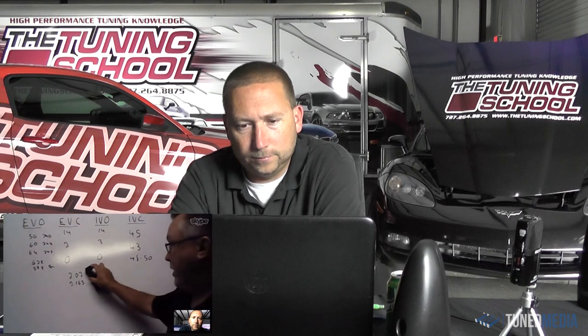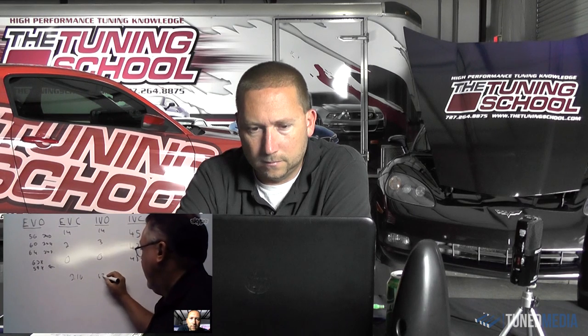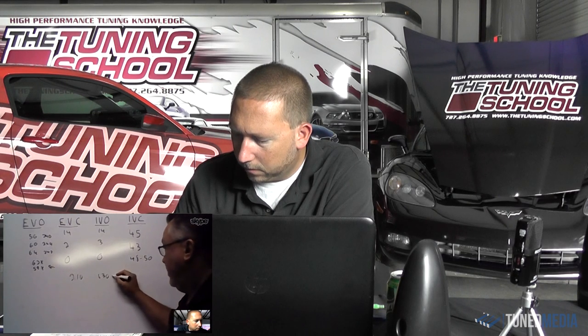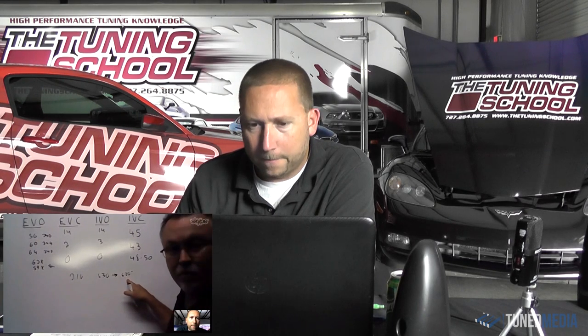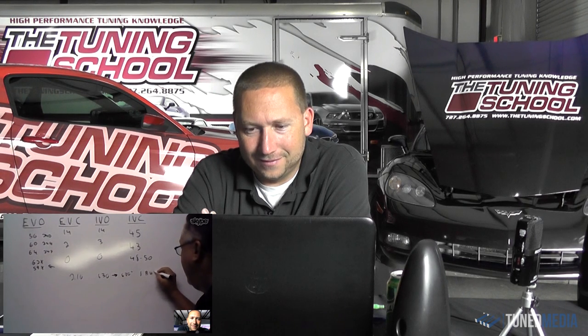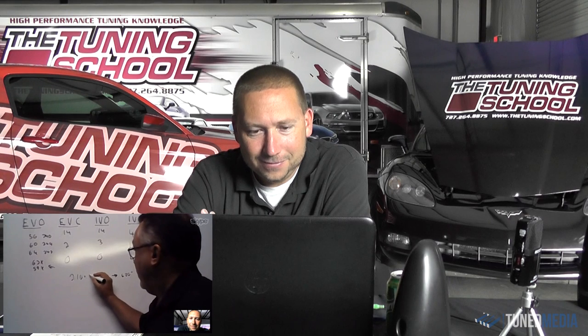And I'll tell you a good story. I had a customer with a naturally aspirated nitrous engine, Trick Flow 245 heads that we did. Of course, it has a 2.100 valve, and he had 630 lift, which is right at that 0.3 number. We went from 630 lift to 680. Guess how much horsepower the thing picked up on the chassis dyno. One. So we've determined that this 0.3 is a good number.